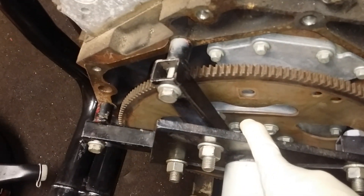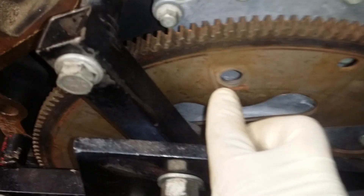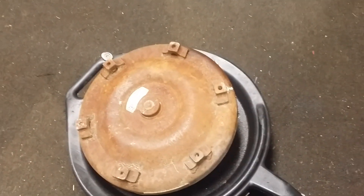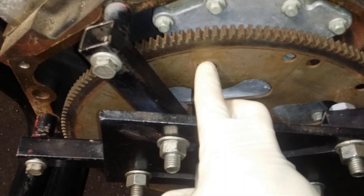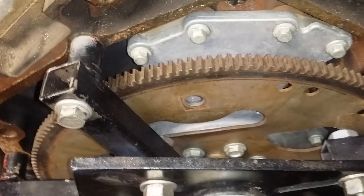The only other modification you have to do is if you're using an older transmission with a standard bolt circle for the torque converter — you've got three holes. You need to take your die grinder and open those holes up maybe an eighth of an inch, oval them out. Or you might even get lucky and use one of the other existing holes depending on the brand of converter you use.